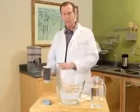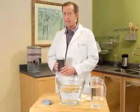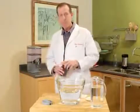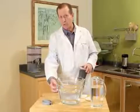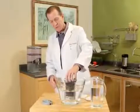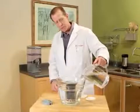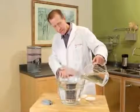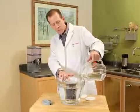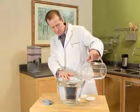Now we're ready to perform the pre-soak procedure. This is something that you'll want to do with the new filter when you receive the unit, and you'll also need to do this every time you replace the filter with the replacement component. For pre-soak, you need a bucket or pail or whatever receptacle will hold enough water. You put the filter cartridge in and you add water until you reach a level that is just under the top of the filter. In other words, it'll come up right to about where that rubber gasket is. And that's the appropriate fill level.